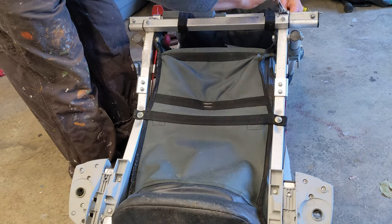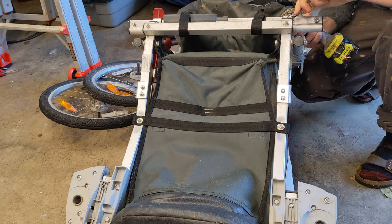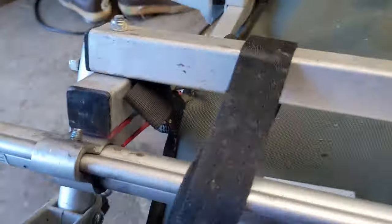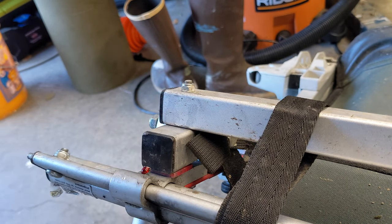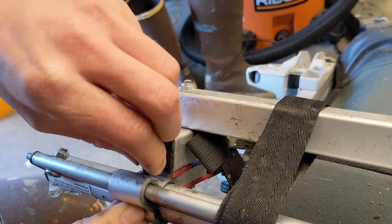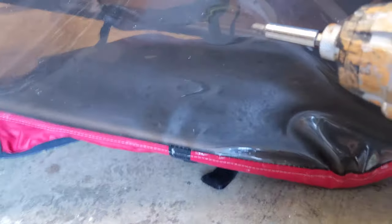After that we'll remove the wheels. We found a loose 10 millimeter nut, so we're going to go ahead and take that off using a Phillips head screwdriver — I'm just using an electric one at this point to loosen the bolt — and then we're going to apply some red thread locker to this. Only use red thread locker if you're never going to disassemble; otherwise use blue thread locker. You can always get red off with a propane torch, but generally I just use it for things I know I'm never going to take apart.